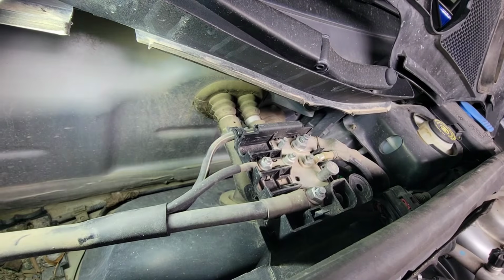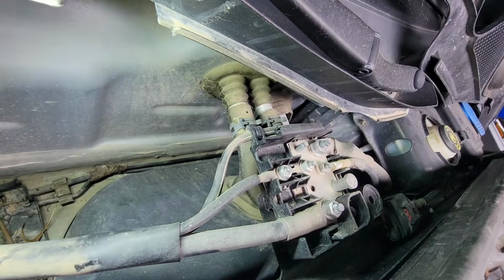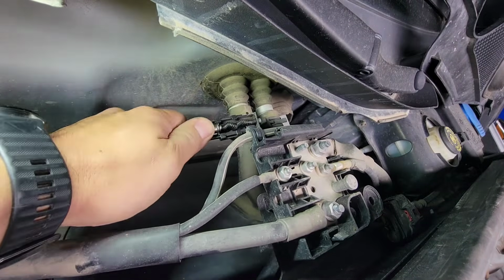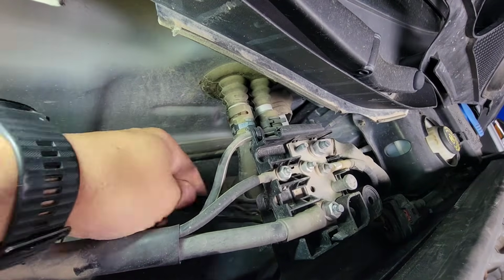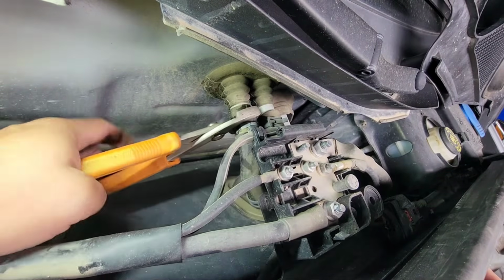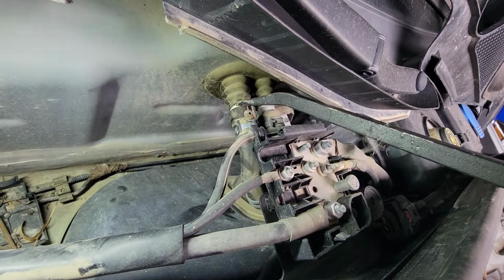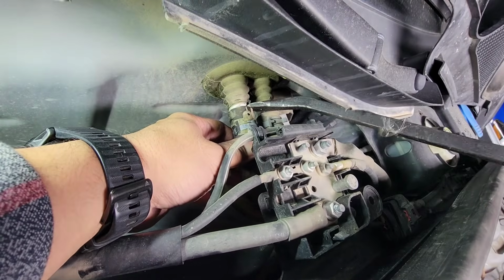So I'll set you up really close right here. We have to peel this hose clamp out, and then we'll pull that hose out. We're gonna use this special tool here to get the clamp off easily. Peel that off. You can see that thing is coming out already. We're just gonna use these pliers to crack this hose loose from the heater pipe. To peel this back, I'm just gonna use the pry bar here, and slowly pull it out.